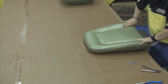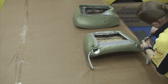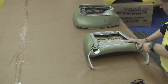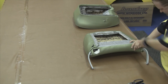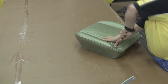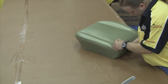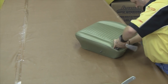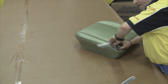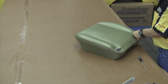As soon as you flip that over, if you need to apply any heat or you have any major wrinkles, you'll know something has gone wrong and you'll need to reapply the process. The seat adjustment post is attached after your seat cover is attached. Sometimes it's a good idea to leave this hardware in, but this washer is so big it's difficult to cut around it after the seat cover is on. Randy is locating the holes where the seat catch bolts to the seat frame through the seat cover. It may be a good idea to put the bolts into those locations before putting the seat cover on. If you leave one seat intact while reupholstering the new cover, you can use it as a guideline for where those bolts need to go. After your seat cover is on and you're happy with the way it looks, attach all your hardware — that should complete your seat cover installation.